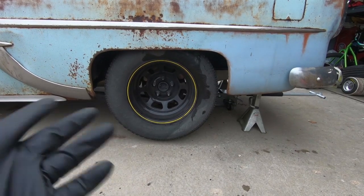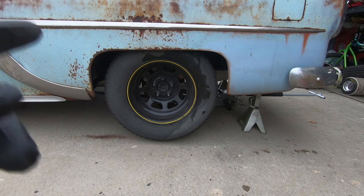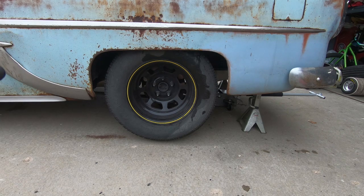On these older cars, things are a little bit more difficult because you can see the wheel arches aren't cut out to where you can just slide the wheel straight in — you kind of have to feed it up from the bottom. What I'm hoping I don't have to do is loosen the shock in order to get enough clearance to get the new wheel in. I think I can get this one out — I did the other day and I actually didn't drop the axle — but we're just going to have to see. We're going to pop these off and then we'll go grab the adapters.